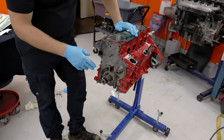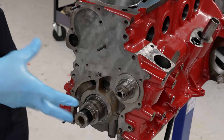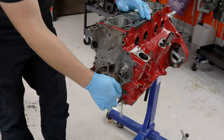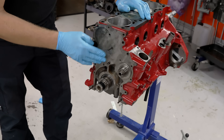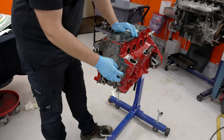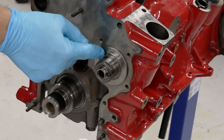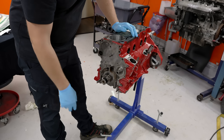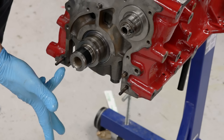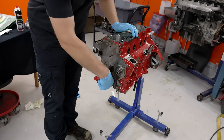One thing you've got to watch out for with these engines is you have this chest plate on here — we say that in Sweden anyway — that goes on the front here. That obviously has a gasket going around it. That gasket is very important. Do not replace that with silicone or something like that, because the bearing play in this axle will become wrong — way too tight — and then you will run this area down. Just put a gasket on here, no sticky stuff. You can put a tiny dab of silicone just along the edge where the two gaskets meet, but other than that, no.